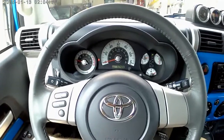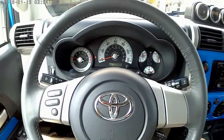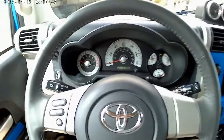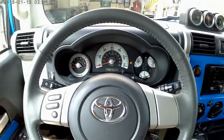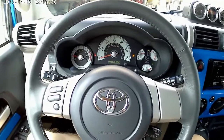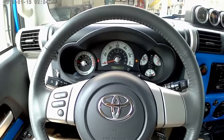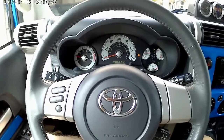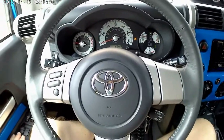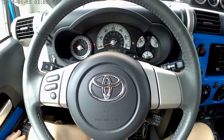So if I do it now, the way it's set up, the vehicle stability control kicks in, I lose power, it puts the brakes on, and needless to say, it looks like my car is dying. But if I go into four-wheel drive, then of course you'll see the vehicle stability control off. Now that's all fine and dandy, but who wants to keep going into four-wheel drive, which is usually what I do. The only thing that's going to be different, when I tap into this one wire down there, it's a blue with a yellow stripe, I'll actually lose my ABS brakes also.